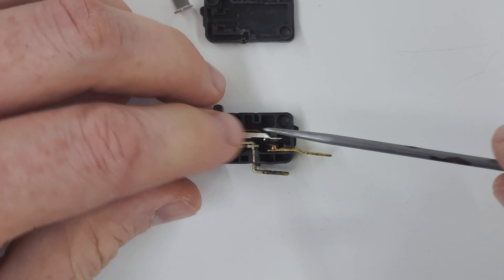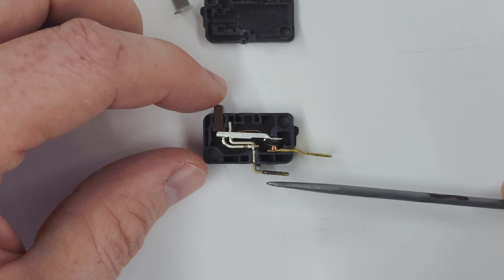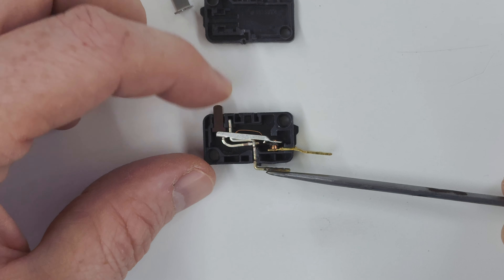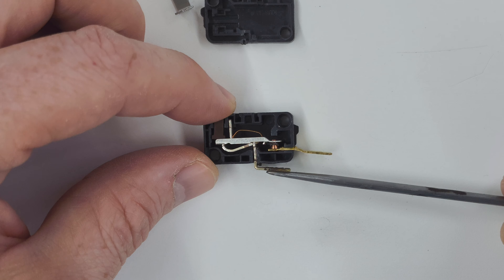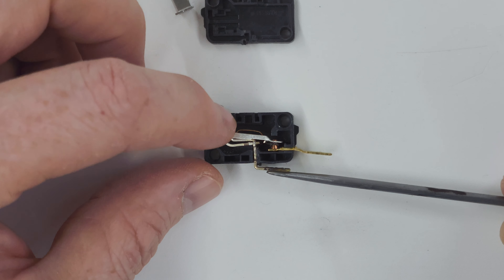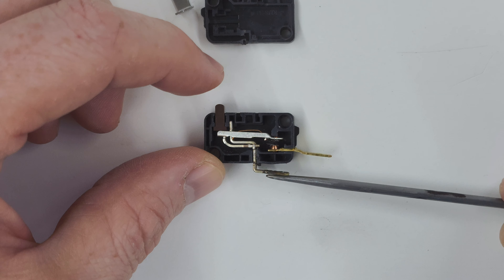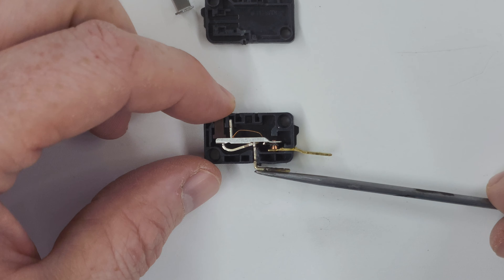The reason that matters is that if you have the wire connector on here and the wire is pushing up just a little bit, when you push the switch down it makes that slide up — and there it is, that is the exact behavior that was happening when the switch was still in the planer. So you take the lid off and the contact rotates to the shiny side conducting electricity; put the lid back on and it rotates to the insulator side preventing flow; then you tap it with a hammer and it snaps back down until the next time you depress the switch.